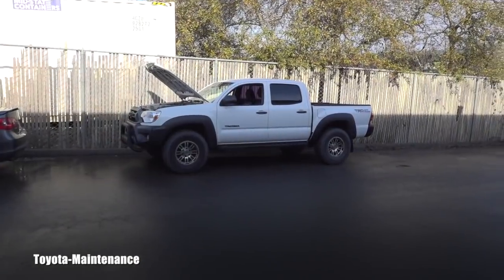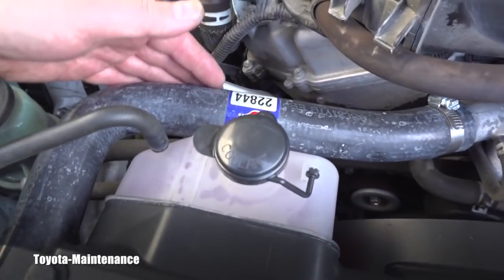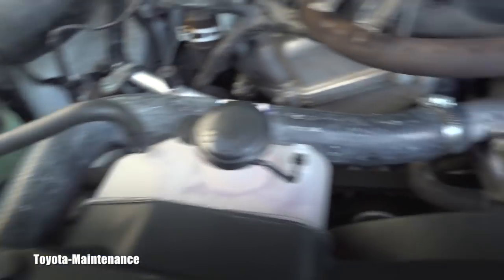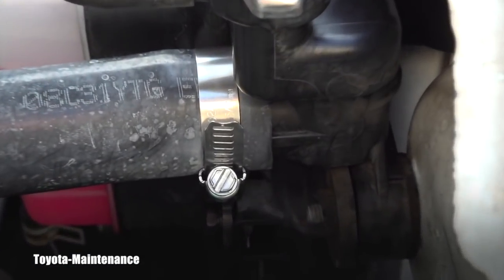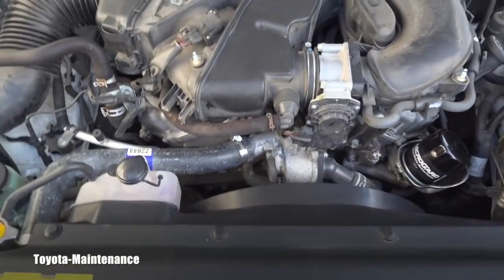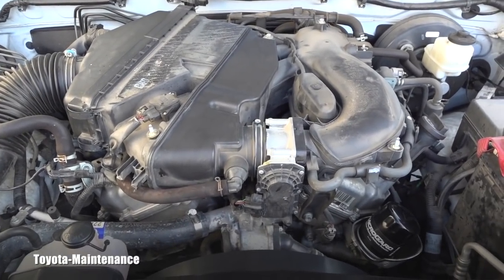About 15 minutes later, let's see how much pressure we have in that upper radiator hose. It's safely warm — nicely pressurized, and hot enough that it burns when I really grab it. Let's check our largest leak — right there — I believe we did a good job. Perfectly holding, not leaking. The primary leak location is also fine. We finally fixed the coolant leak. I can put back the top cover, finish the paperwork, and call the customer. I hope you enjoyed this video — if you did, give it a thumbs up. Thanks for watching and subscribe!